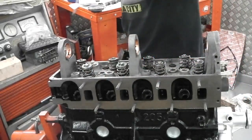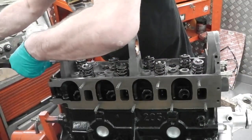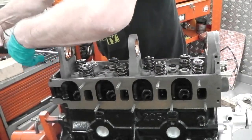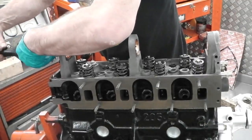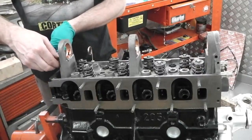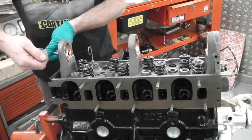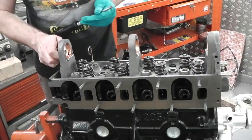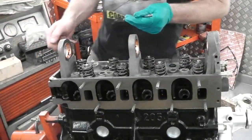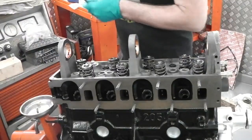And then our securing bracket for the end of the cam's fitted in, just so we didn't lose it at the end here. And now be careful, now that we're working with screws, with the rocker cover off, we do not want anything falling down the oil galley. So it's ultra careful time, because that screw that I've got here could very easily slip down the galley. Yeah, you could get a magnet and fish it out, but you don't want to be doing that. It's okay with a bracket. So it's careful, careful time.